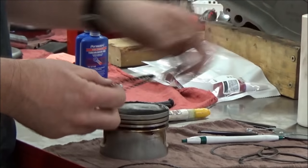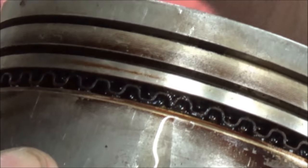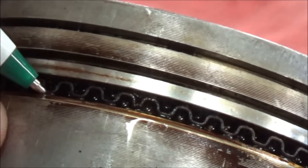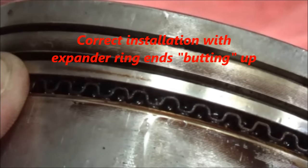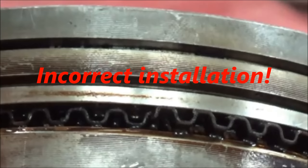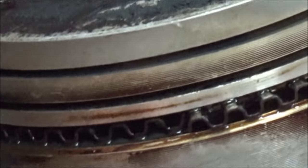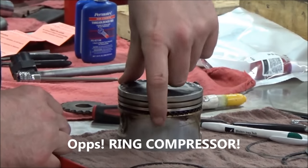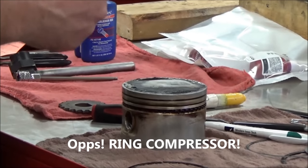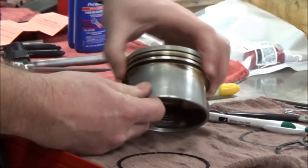So let's demonstrate how to put it actually on the piston. We've got some assembly lube here on the piston and the ring. Just go ahead and get a close-up of this gap before I move on. We want to make sure that the ends are just butted up against each other. The problem is when people put the ring expander on here, you can force that thin metal and wedge it in there with those ring expanders — remember how they had a ratchet on them? So this is easier to do than you'd think when you're not really paying attention.